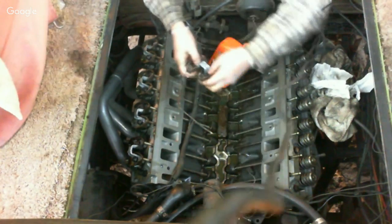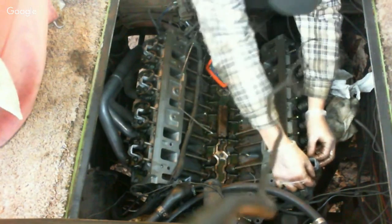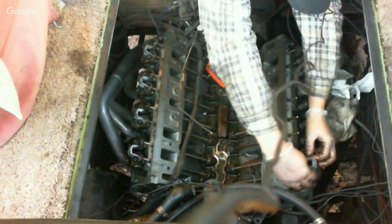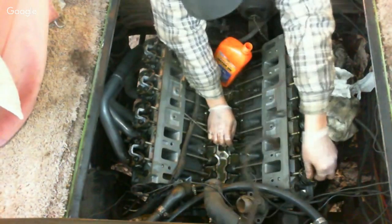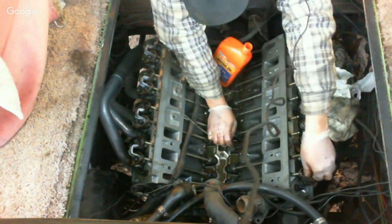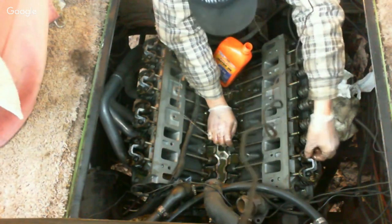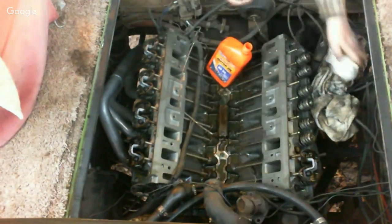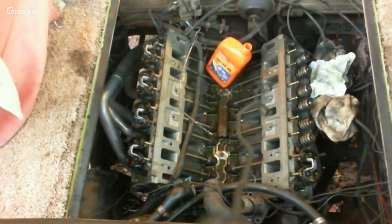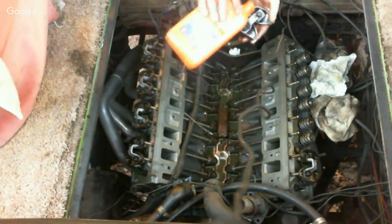It just had the steam and low compression and excessive oil burning, which was because of the valve guides. He had to replace the valve guide in one head. He said it was just completely worn out. So that could have been a huge cause in the oil consumption. He knurled all the valves.